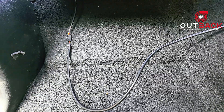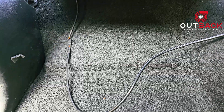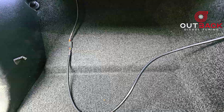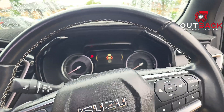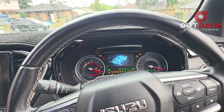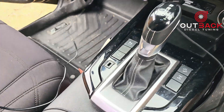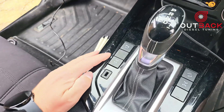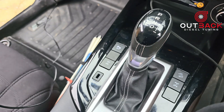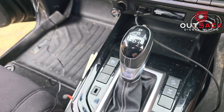Connect the outside cable to the inside cable. Now start your engine and make sure the light illuminates on the switch — that way you know the switch is working. Once you can see the switch illuminates, turn the engine off and put all the trim back into place.